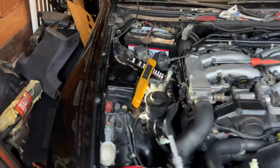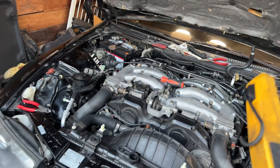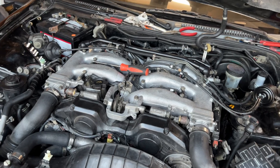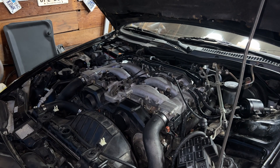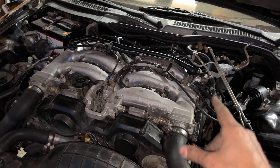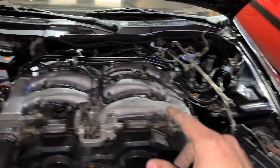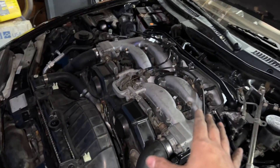Okay, I think we've got everything plugged in. I'm sure there's something I missed - I always have that feeling before I start up my car after doing a big overhaul like this. It's kind of the same feeling when you go on vacation and think you left the toaster oven on. But I checked and double-checked everything - all the vacuum lines are hooked up, all the power wires are hooked up. It seems okay. It's idling a little bit high so I might need to adjust something - maybe the throttle position sensor. But the car runs and it seems to be firing on all cylinders, so I'll call that a win.